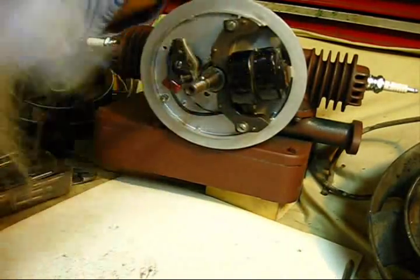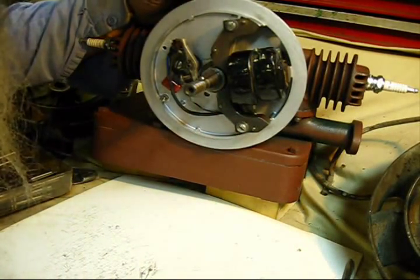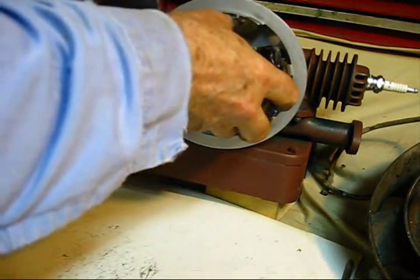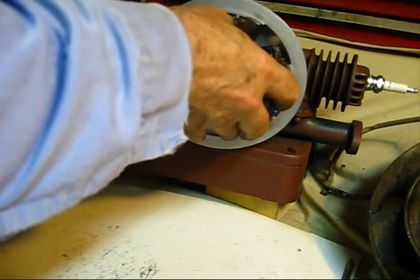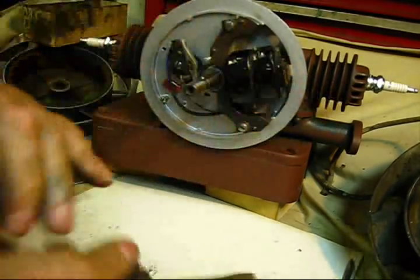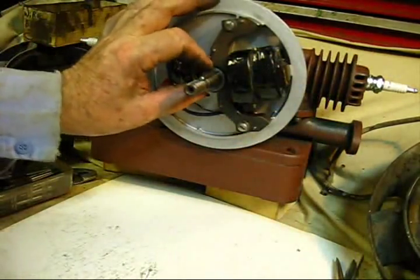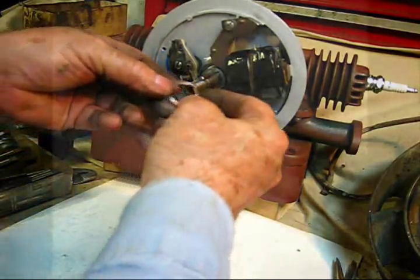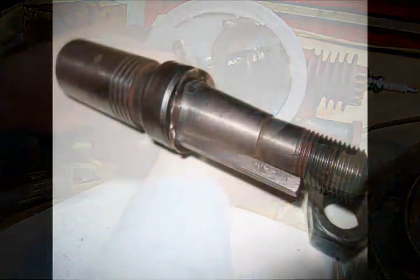In the back, the cinch-up screw — you hold that pressure against the housing and lock that down. That's tight. That's good to go. The wavy washer takes up the slack in this system.